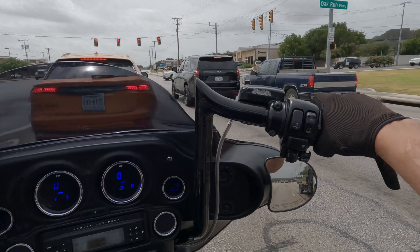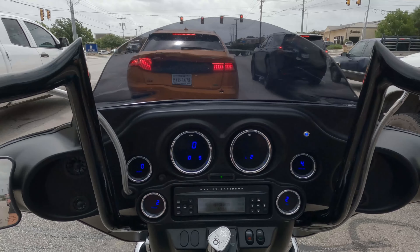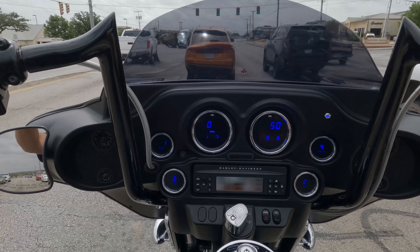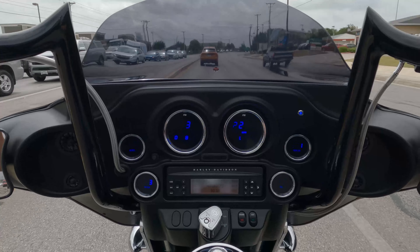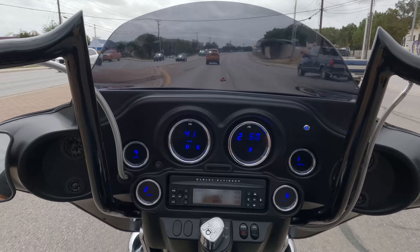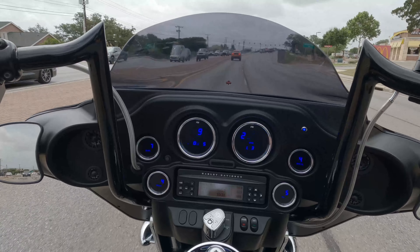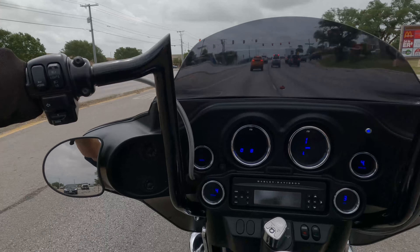When this thing gets hot it's probably detonating — it doesn't have enough fuel, so it's just igniting and that's why you get that stutter off the bottom. For those wondering what that little indicator is: that's the oil cooling fan indicator. When that thing is on, it's indicating that the oil cooling fan is running. It would probably be advantageous to have a full tune in this thing — it would run a little better — but for heat cycles it's going to be just fine.